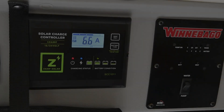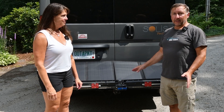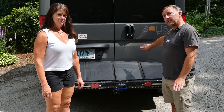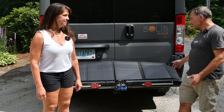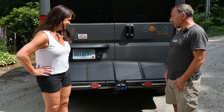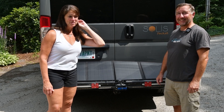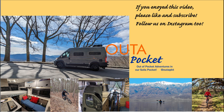Let's see what we've got for charging. With the extra panel now, angled at the sun, we're at 6.6, 6.5 amps. So to wrap it up, it looks like we've gone through the right procedure. If you're going to hook up an external solar panel, test the polarity and figure out what connectors you need. I was able to snake the wires through the corner of the door, so if we're out for a couple of hours we could leave it like this. I think now it's a success — whenever you need a little extra power, this will work. If you like this video, please like and subscribe.